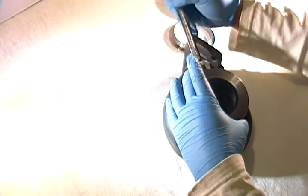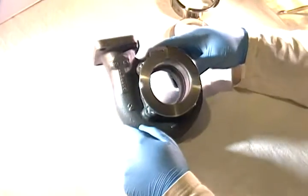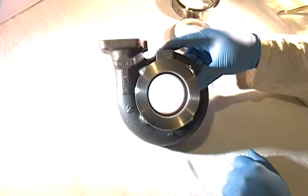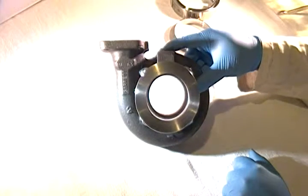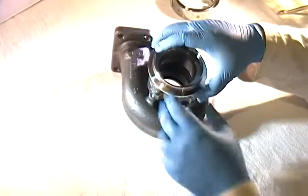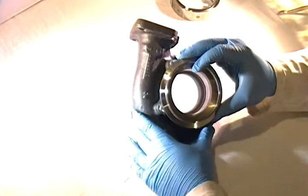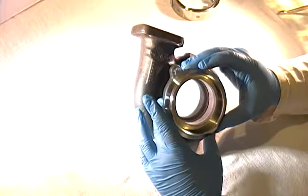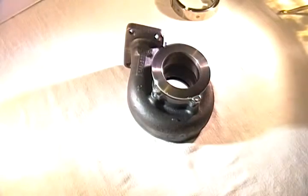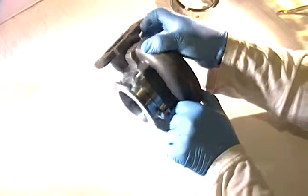You don't need to do anything ridiculous in terms of specific foot-pounds. This is it — just set that here. Notice how the entire opening of the volute for that exhaust housing has no blockage into it, so you know it's definitely made for a Garrett-style turbine housing. It's stainless steel. Notice how when you have the weld flange, the same thing happens — there's no interference for the outlet. So this is a great way to convert your turbocharger into one that has a V-band flange.